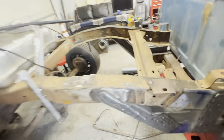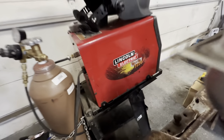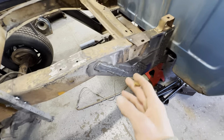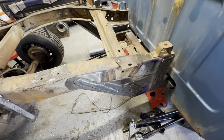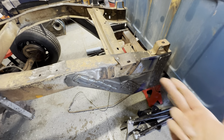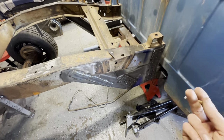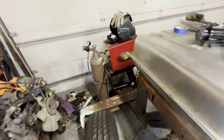So I think it was thermally timing out. It's one of those, like, it's a smaller, what is it? Great for sheet metal and small stuff. But when you get into 3/16, almost a 1/4 inch onto a 1/4 inch, I think you got to run it 10 seconds and let it cool 10 seconds. Run it 10 seconds and let it cool 10 seconds. You can't just go with it.